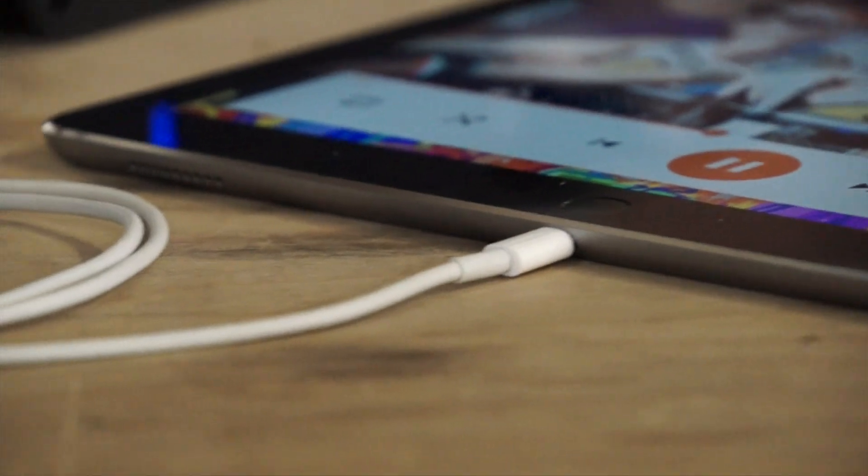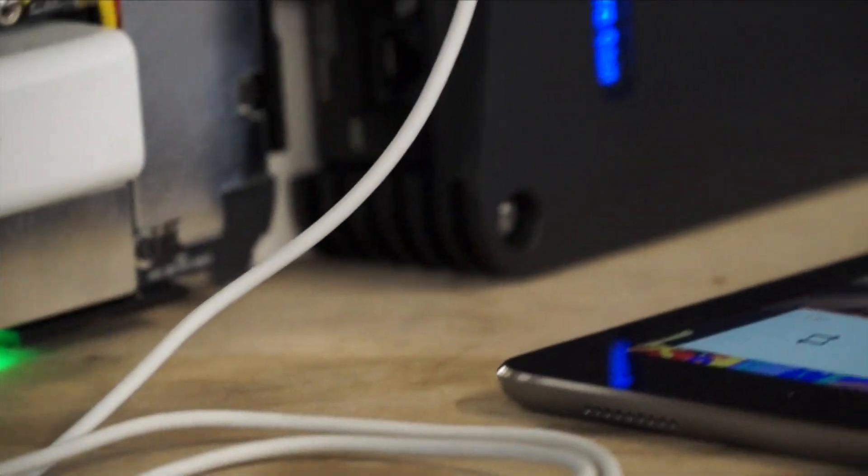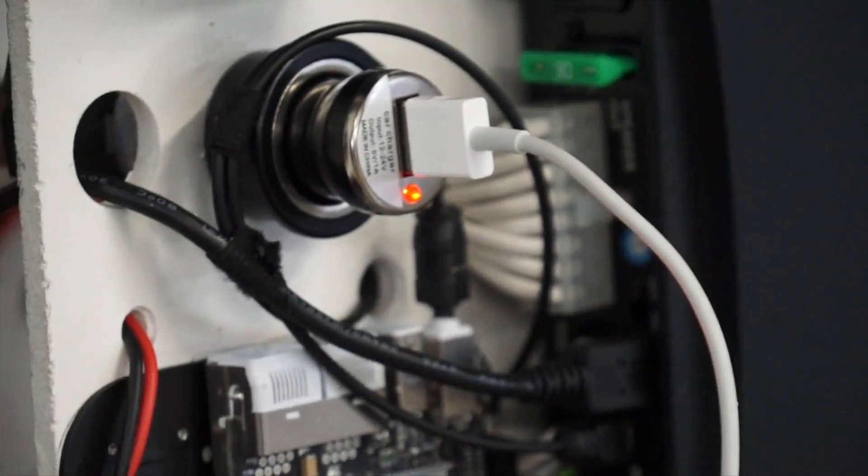The Airport Express is going to be hooked up to constant power, so the wifi is going to be always on. I want to hide a switch for that so if the car has to sit for an extended period of time, I can turn off the wireless router. The second switch will be for the cigarette lighter plug, which is hooked up to accessory so it turns on with the key. That way the iPad screen turns on and starts charging when you turn the key on — but I may not want it to always charge if the iPad is fully charged.